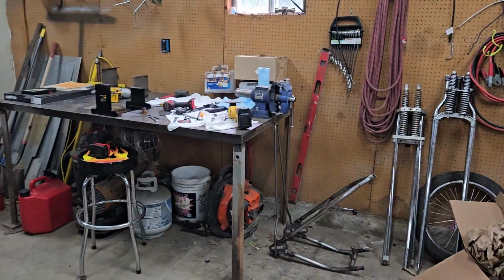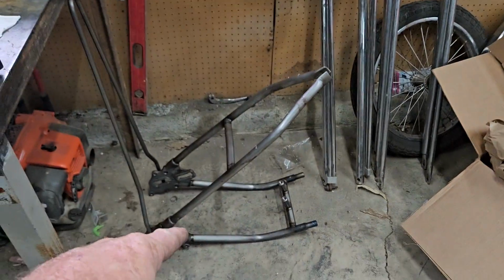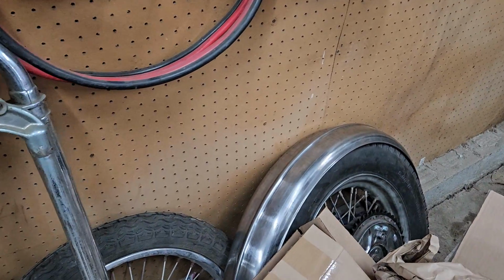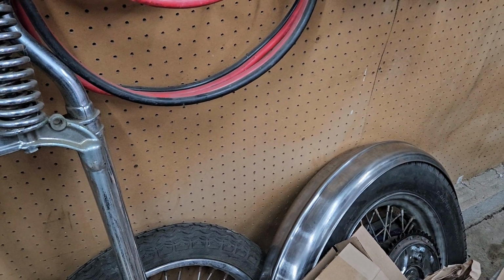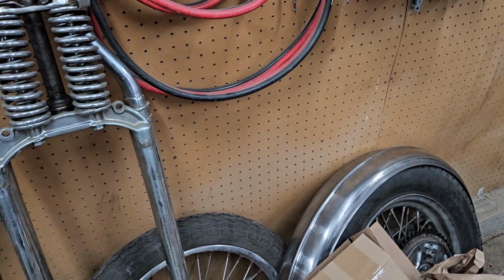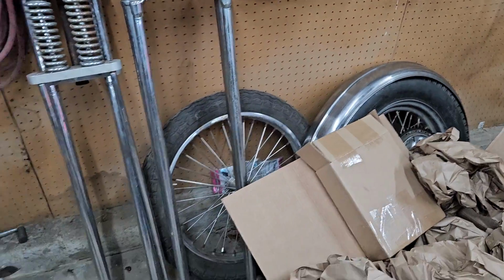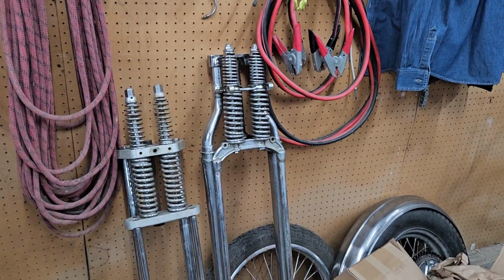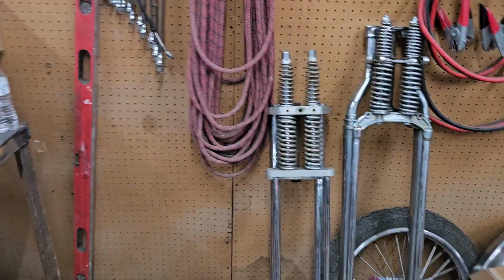But 60 bar's been up. I'll probably cut it down. Hardtail kit. I've got that fender over there. Now that fender, I bought that just to make the backside of my seat pan with. I'm going to put a fender like that on this bike, but it'll be a more heavy duty fender. That thing right there is only like maybe 20 gauge at its best. I'm not running that as a fender. I'll get the rockers rebuilt for that long dude there and find somebody that can rake a frame for me. I'd love to run that front end on that bike.